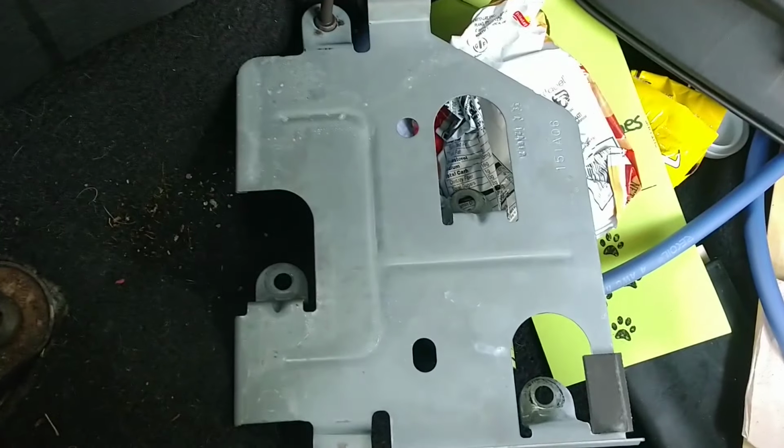As you can see, both computer modules are there. You take two, I think they're 11 millimeter, loose, and then you slide both computers off. I'm gonna call them computers for simplicity. Then there's three other screws there, there, and there. You slide them off, and then you can pull the metal bracket off. Here's your bracket, by the way.